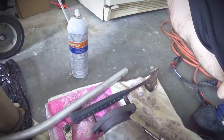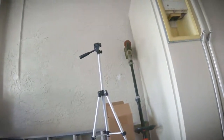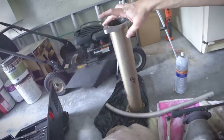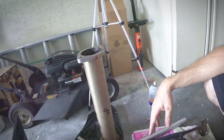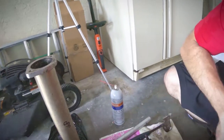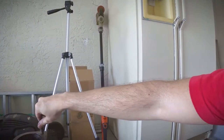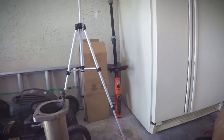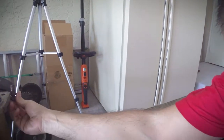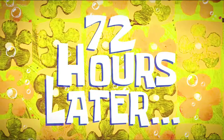One more thing: when you take the cat out, those two bolts are actually part of the cat's flange itself. The test pipe doesn't have the same thing on the back end of the exhaust, so I'll need to go get some new bolts — two for the front, two for the back. The stock bolt is too fat, so I'll need to go one size smaller with the corresponding nut, and I might need to go a little longer too.